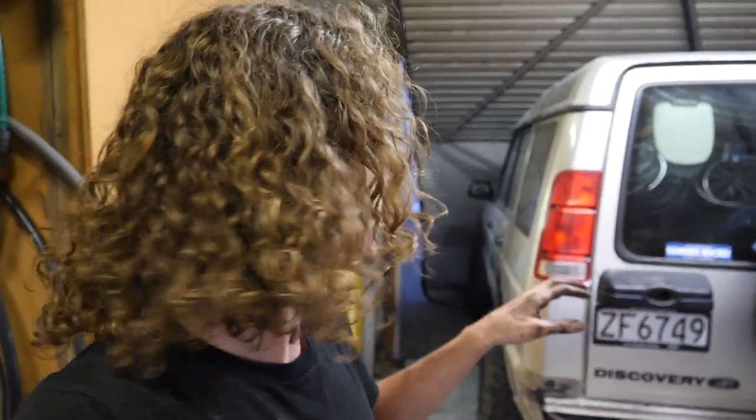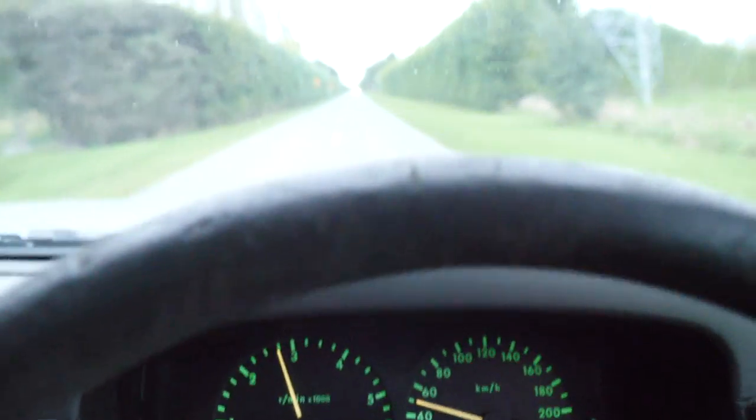And that should sit really level then, so I'm really happy. I didn't go with the full 50mm of lift that I was originally thinking I'd do. So we've gone 50mm of lift in the front, 40 in the back, and I'm sure that should have us sitting pretty level by the time everything is all squared away. So with that, I reckon we'll start packing up and get the truck out on the road for you to have a look at.